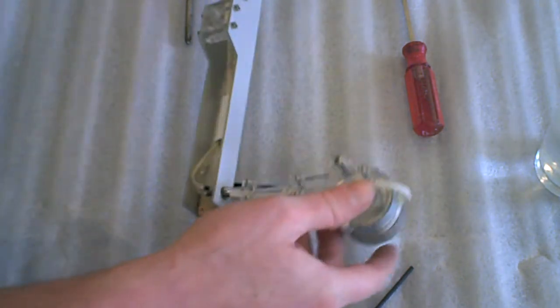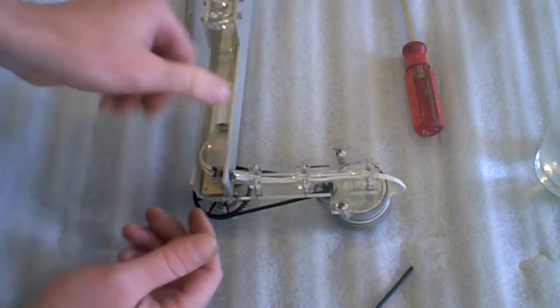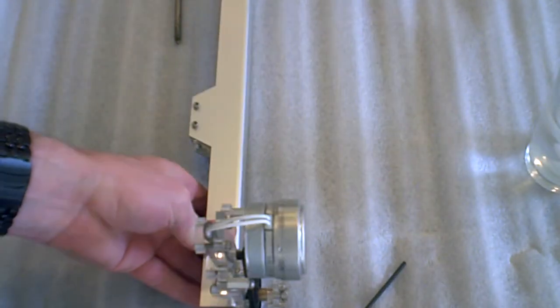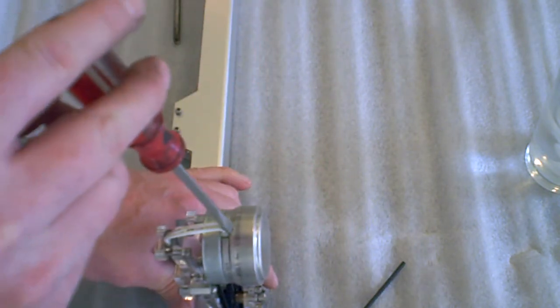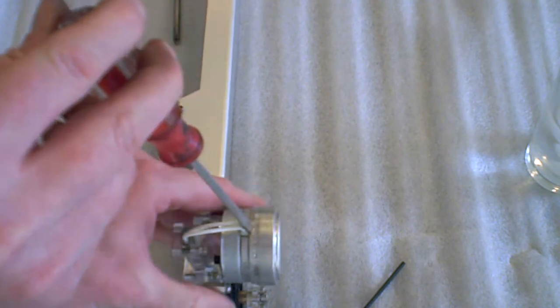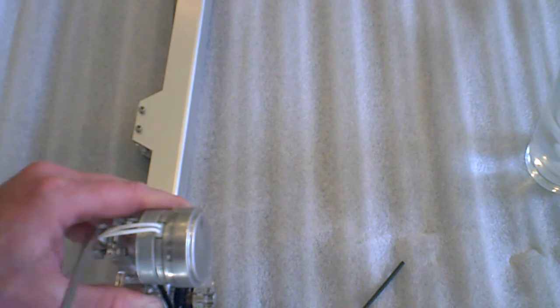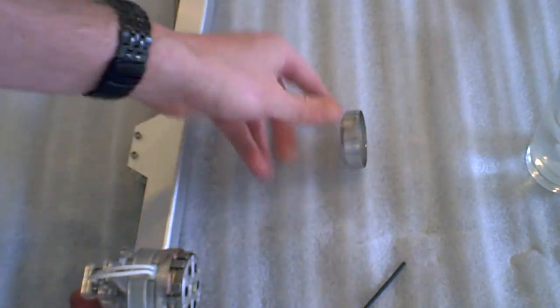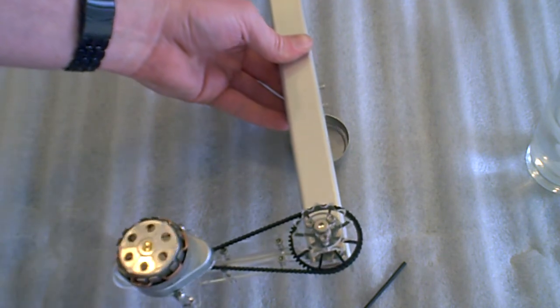Now, pull the wire back tight. Now, if you want to be able to take this thing off, the easiest way I've found is take a plain old screwdriver, put it above the little wiring harness here, and catch the edge of the top, and just twist it off, or pry it off, I should say. Ta-da! Now you have a nice little motor. Zing! The end.